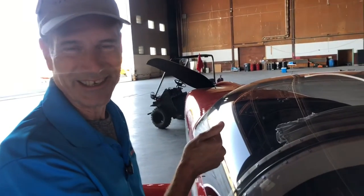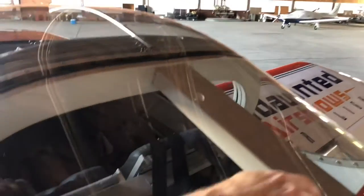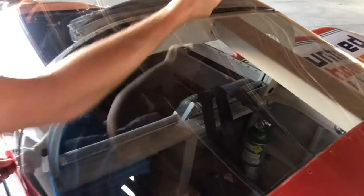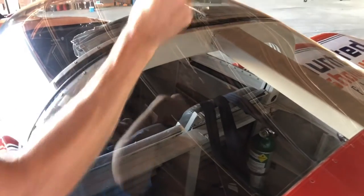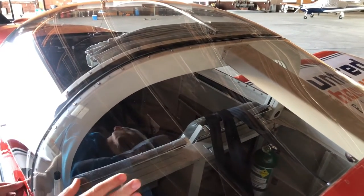So if I'm able to, absolutely want to have me disengage it. Otherwise, you'll have to break into the canopy. A sawzall or a rescue axe anywhere, either in a corner. Sawzall, really good on the bias. Reach up and under to disengage that, or from the opposite side if you have to, just cut and peel away the canopy.